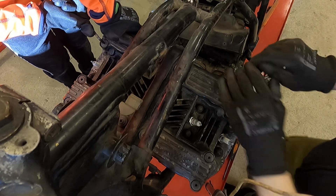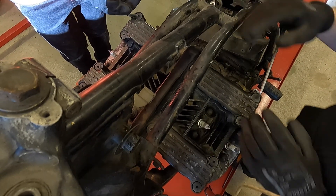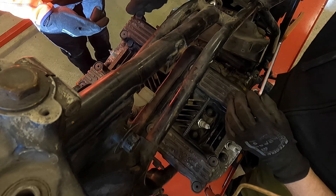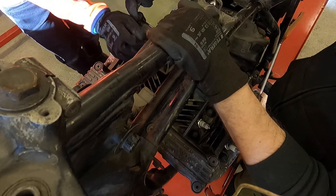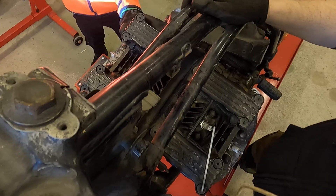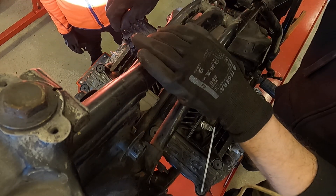The valve cover is attached with six Allen bolts per side. This time the bolts are unlocked in a random order. When the bolts are open, remove the valve cover from the cylinder head. In this case we had to help the release a bit with a rubber hammer and a screwdriver — I place the screwdriver between the outer edge of the bolt thread hole in the valve cover and gently twist upwards. As you are still watching, I assume you are my kind of subscriber, so hit the subscribe button and bell icon to keep up with this build.